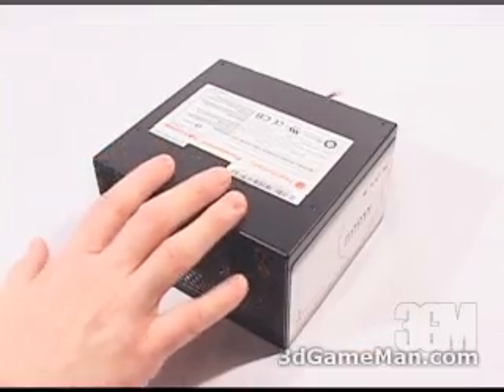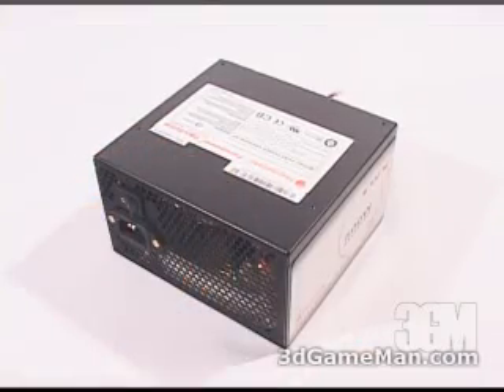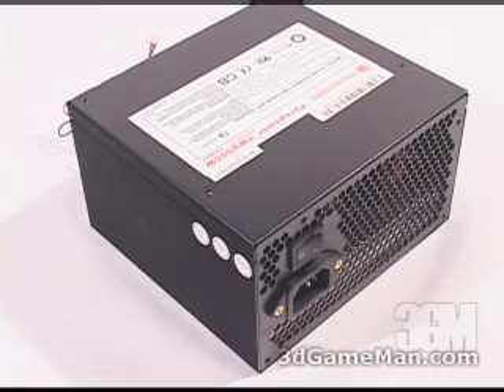This particular product has a continuous wattage of 500, which is ample power for today's computer systems. To understand how this wattage is determined, you need to know what rails are. Rails are basically well-regulated transformers which convert domestic current into the voltages that your computer system can use. There are essentially two different rails: the 3.3/5 volt and the 12 volt rail. The approximate maximum peak output of the 3.3/5 volt rail is around 135 watts and the 12 volt is 450, which is essentially how the wattage of this power supply is determined.